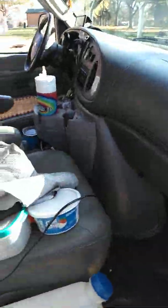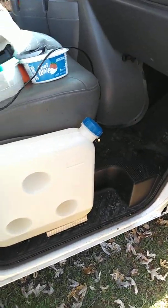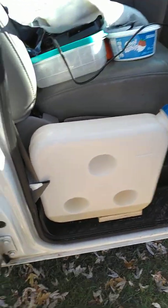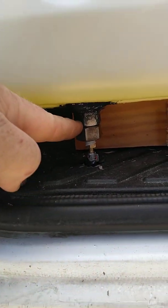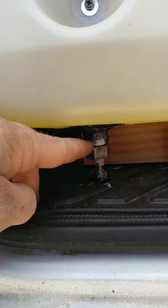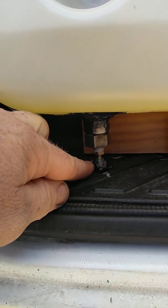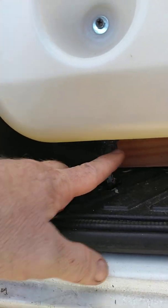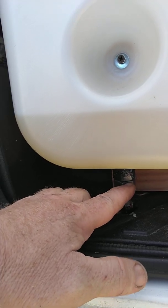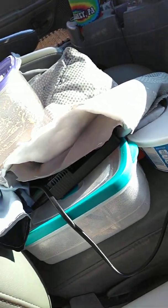Childhood memories. But anyway, these kits come with supposedly everything, and if I wouldn't have been gypped out of the, but I'm actually glad because, like I said on my other video I'll be uploading, my buddy Scott made this custom out of a 3/4 inch bolt, drilled it out, tapped the end for the fitting for the hose line, for the fuel line. I actually feel that this is way better and gonna not leak. I do believe.